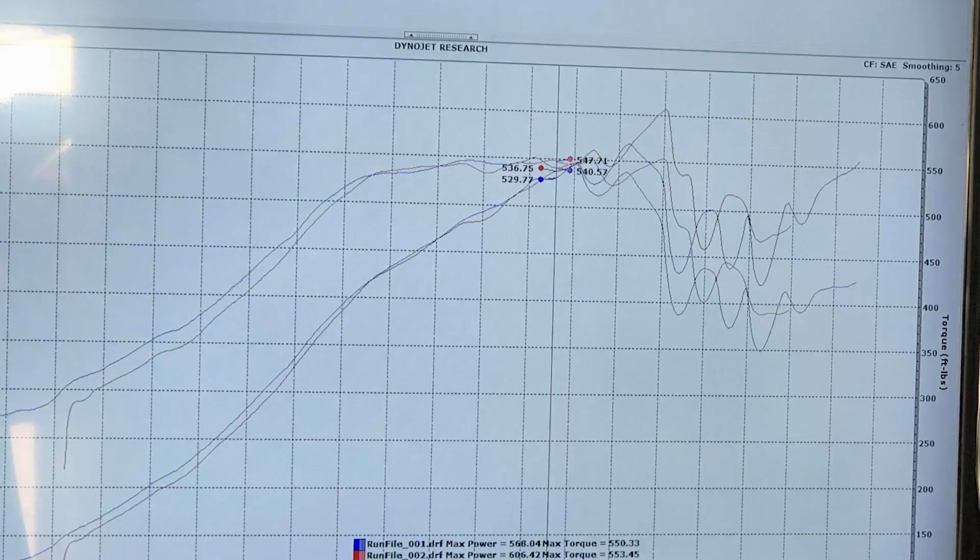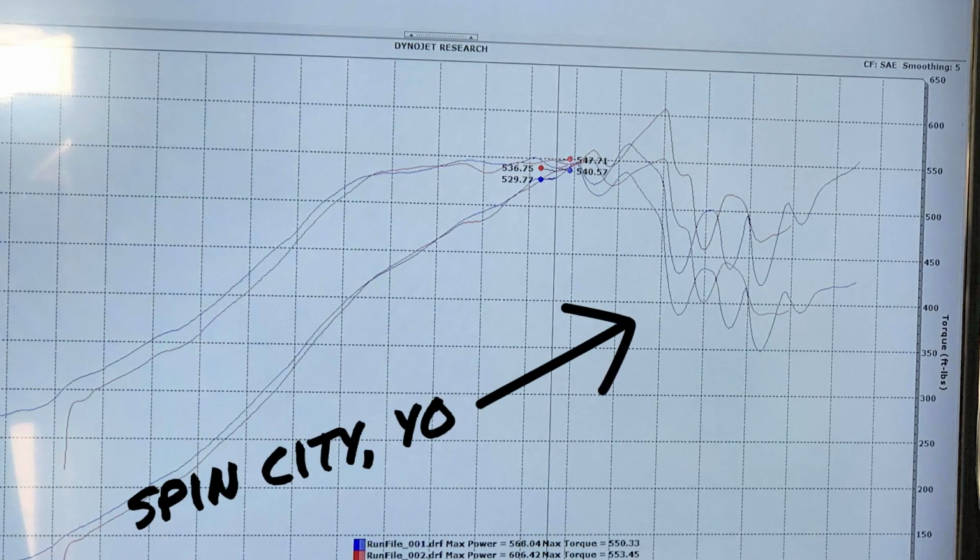And as I'm watching the dyno display, it rips up to 5, and then it just kind of flashed, and then pegged over to like 9 on the dyno display. So I lifted, but that just resulted in me stopping the pull at 5,000 RPM. It didn't really go to 9,000 RPM for some reason. It just didn't have a tack signal that worked pretty good. So fixing that now, and we'll do another pull here in a minute.